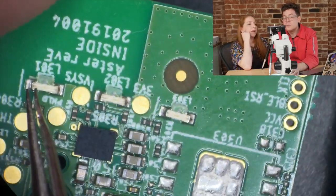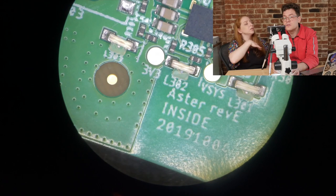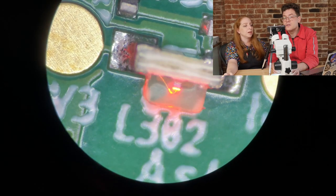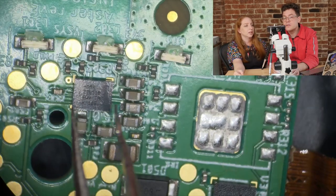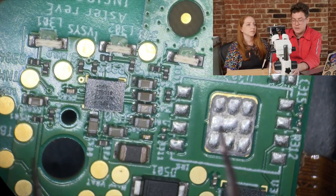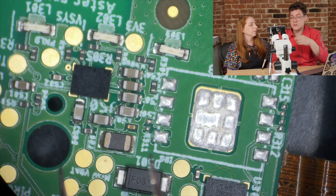There's a lot of support circuitry. Usually when you see a lot of capacitors around something, it means that part of the board cares about power — you want it to be level and clean, so you see a lot of capacitors around. There's also a chip with a QR code that says 'SH' and then '141' — I wasn't able to scan the QR code. It's near the USB port, so it could be some kind of USB controller.